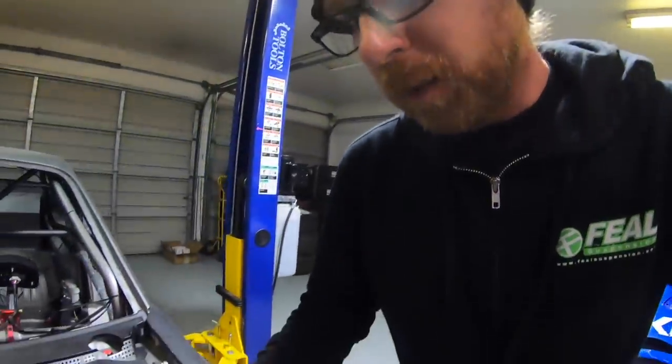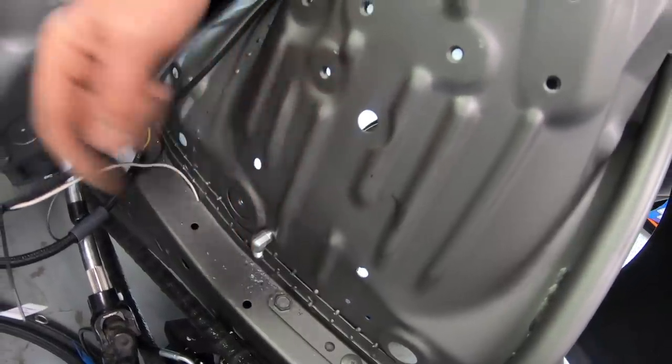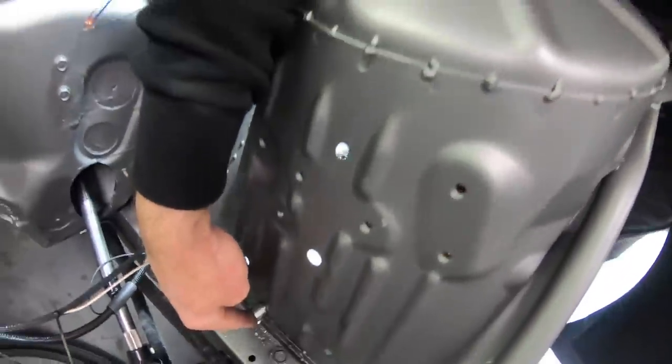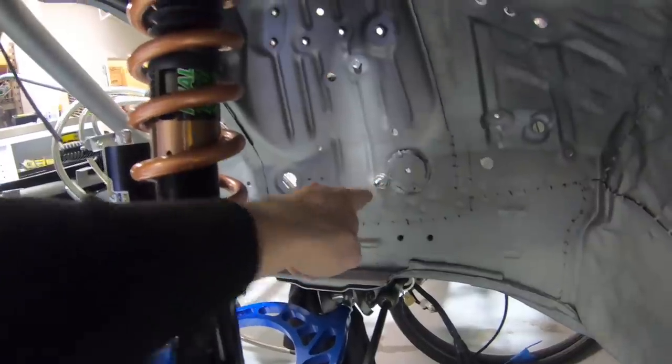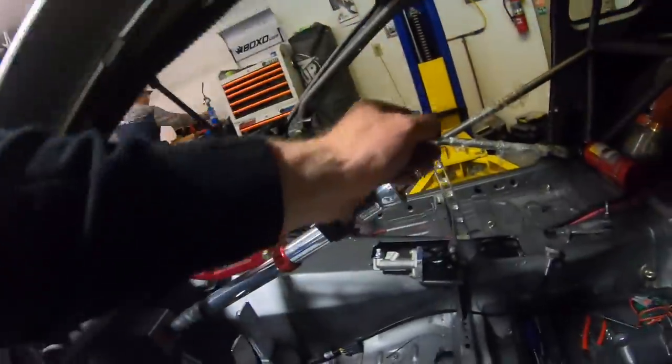We started by drilling some holes for the bulkheads. This bulkhead for the front brake goes from the pedal box through the firewall, down through the wheel well, and ends up right there. Then we snake that to the caliper — connecting the dots: pedal box to firewall, firewall to wheel well, wheel well to brake caliper.